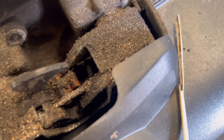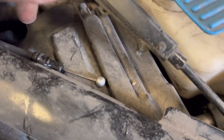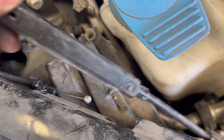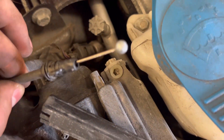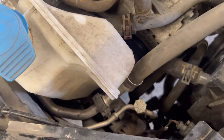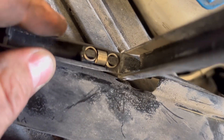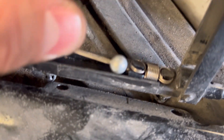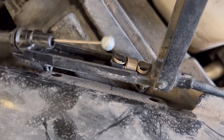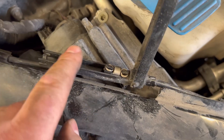If you have a look here, that's extremely dry — that's not going to help. The cable comes in two halves: you get this part here and the front half. That goes from the bonnet into the car, and that goes from here across the front end through the catch. What's happened is the catch has been a bit too much for the cable and ripped this end off. What should happen is this ball fits into a tab and then pulls and works in perfect sync — it ain't doing that. So it needs the front part of the cable replaced.